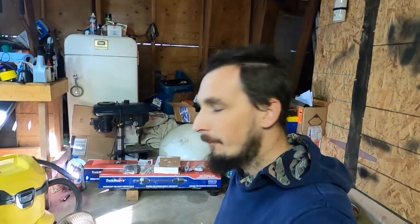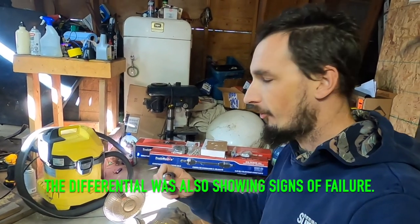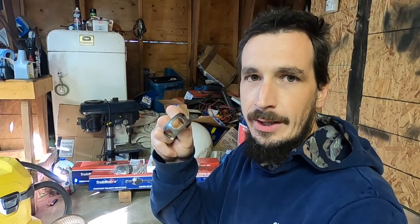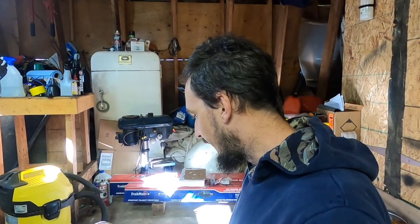It's time to address the weak link on my V8 Mercedes. The differential didn't actually fail in the car, but the CV axles are the weak link — that's what blew up the carrier in one of the aftermarket axles I was running. I put in a good used factory Mercedes axle and I've put another thousand kilometers on the car since without any troubles. I found out through research that Mercedes actually upgraded to a heavier differential unit in 1990, and my car is an '89. I could have gone and got one of those, but then I might run into the same problem sourcing good axles.